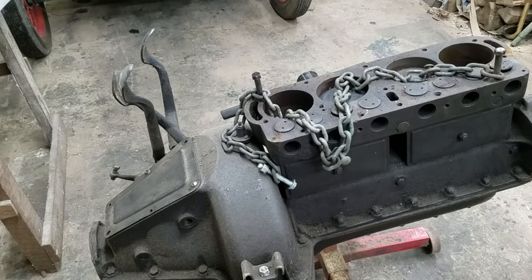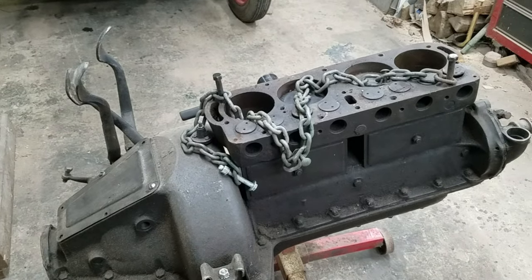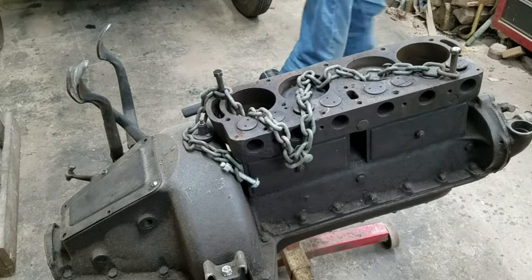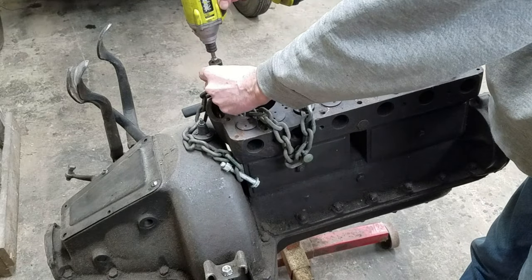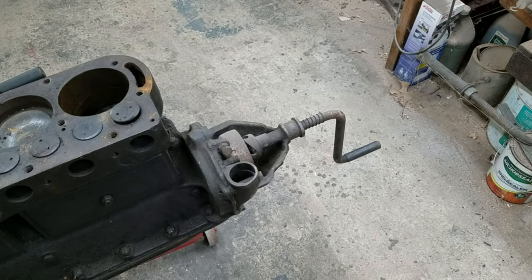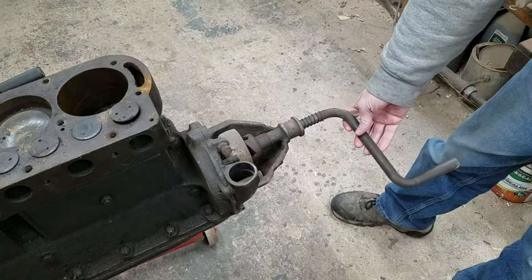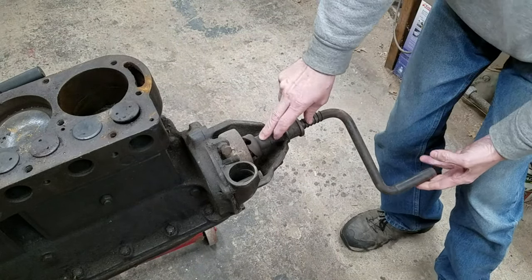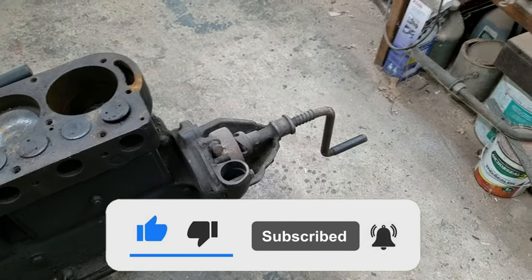It is connected to the driveline through a 2-speed planetary transmission that we are going to explore. First, let's unscrew this. Hang my chain back up on the wall. The next logical step for me anyway is to get this shin basher out of the way. And to do that, it looks like it's already been ground a little bit. So we're gonna try and bang that out. If it doesn't come out, let me get you in a little closer.